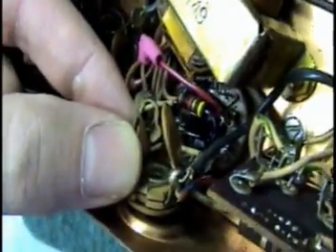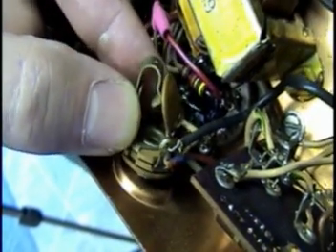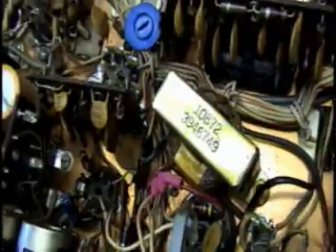When reinstalling your audio jack, use caution. Make sure that it's not touching those terminals. On this one I had to bend one of the cap terminals down to clear the back side of the audio jack. The jack is installed now with plenty of clearance — everything looks good. I'll fire it up in a minute. I just want to point out that while you're in here, there are a couple of other electrolytics you might want to look at: there's a 10uF on the audio tube, a 1000uF in the rear, another 8 or 10uF here, and one tucked down underneath this board — another little 10uF. So if you're going to go through the pain of changing this filter cap, you should change all those too.